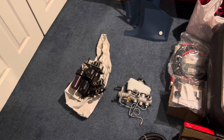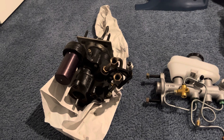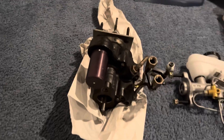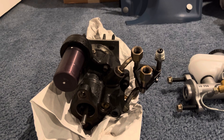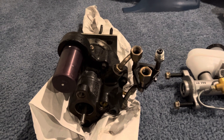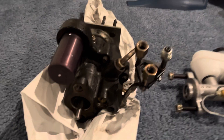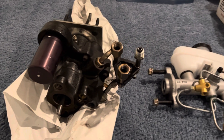Today I'm going to show you how to convert to hydro boost for 96 to 98 Mustangs, and I'm going to show you everything you're going to need to make this work. I'm choosing the 96 through 98 hydro boost because it's a little bit thinner than the 99 through oh-four, especially if you're doing a coyote swap — which I'm not, but maybe later down the road.